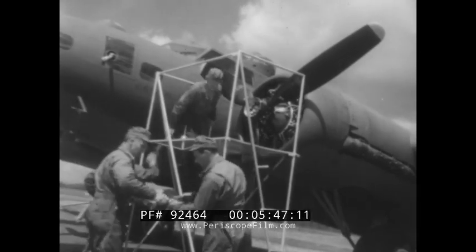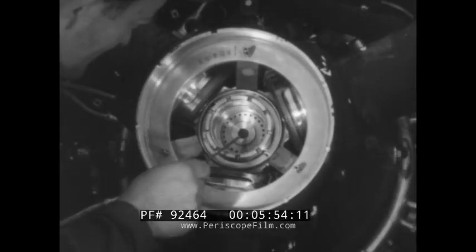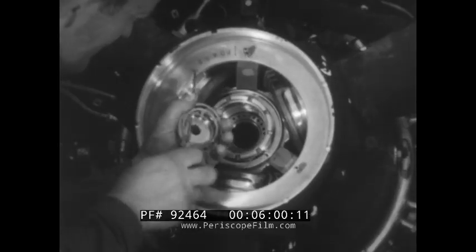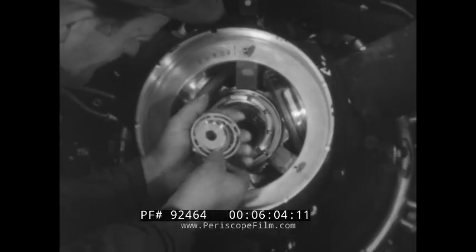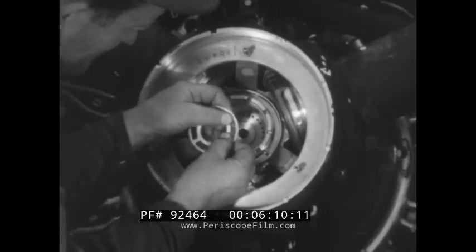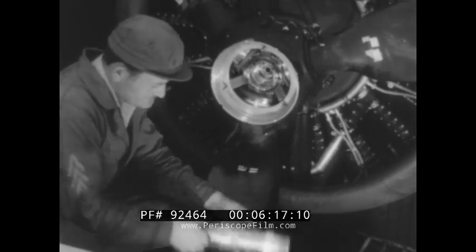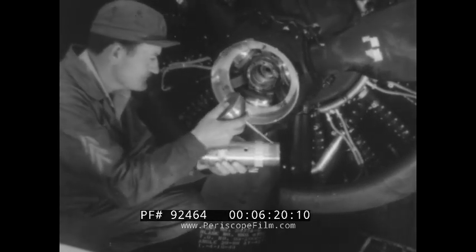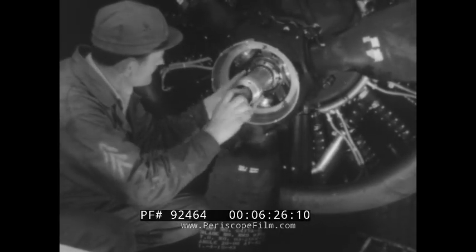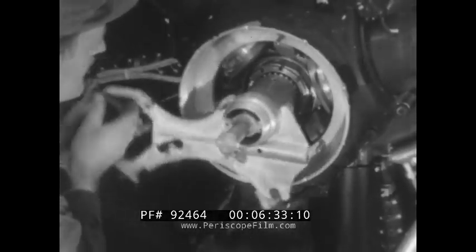Up goes Mel to get ready for the next item: the transfer plate and its copper gaskets. These gaskets stay right in the engine shaft as a rule. Mel fishes them out for a check of their condition — the gaskets have a tendency to become stiff and brittle with use. If they're soft and can be bent easily, they're okay. The groove side of the transfer plate goes to the rear, the smooth side to the front. Now to install the oil distributor valve — first, a little oil on its threads before being turned into the shaft. I start it by hand, then finish the job with the lightweight distributor valve housing wrench. Whenever possible, I use the heavy-duty type wrench for this job, if available.